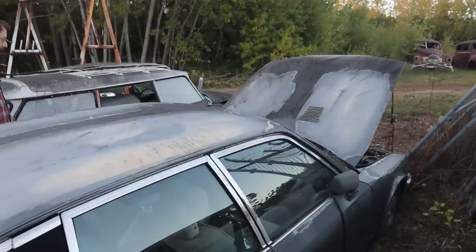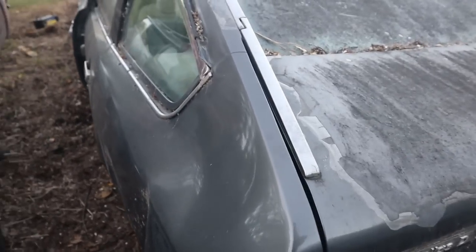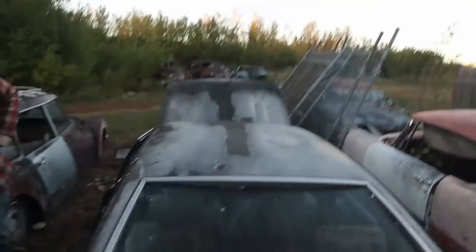Yeah. It's dirty and it's rusty, and the usual. Dented on the back here, punched in the rear here. And it's got a bent frame, and that's the real tragedy. The towing company that delivered it to my house put the tie-down strap through the subframe and then got the car to my house and started it. And, as they will, the hydraulic suspension was strong enough that it just jacked itself up and bent its own subframe in half and tore it away from the floor pan.